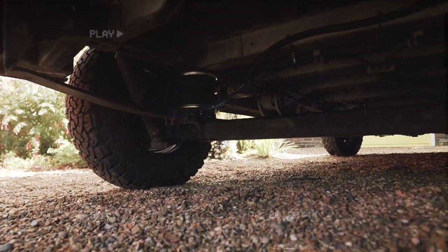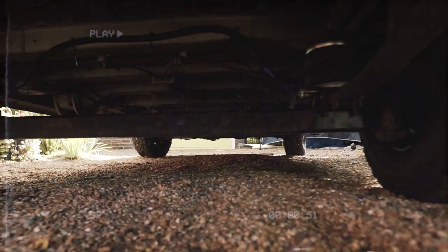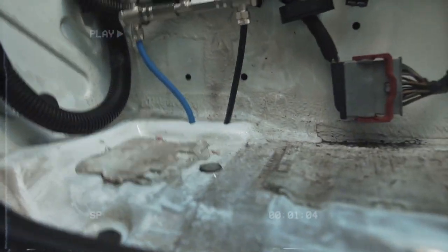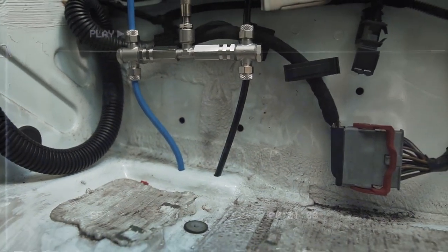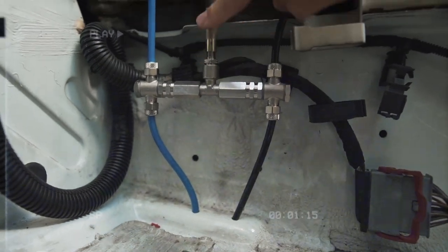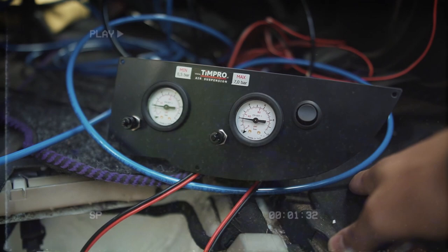It's a few days later — put back because of the rain. I've just routed all the cables around the top with a bit of conduit there to protect them, and that runs all the way down the driver's side chassis leg. I've come up from underneath the step here — drilled two holes, which I will be fitting a gland and protecting a bit more. I just wanted to plumb it all in to see if it would actually work. So you've got left and right hand side, and then the top is screwed into the compressor. That's all wired in — I took the power from a piggyback off the fuse box on one I wasn't using. Everything's then plumbed into this control unit.